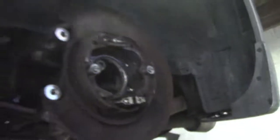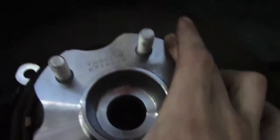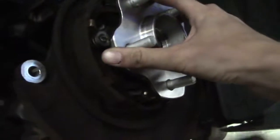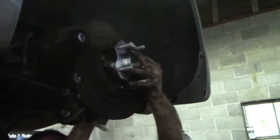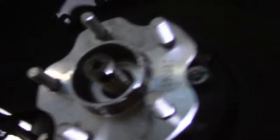Alrighty, I'm gonna put the camera down and help him, so we'll get this put in there and then go from there. Alright, slide the axle up, gives you some room, and everything just falls right back into place. Got some bolts in it, should hold itself up now. Put those 4 bolts in, torque them down, and then put your axle together, and then we'll get on the brakes. Got that all torqued down. The axle just slid right through there.